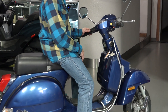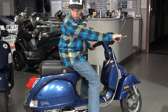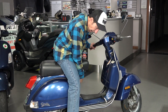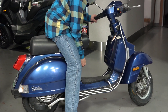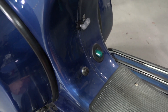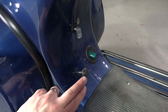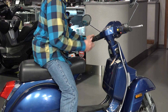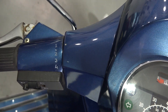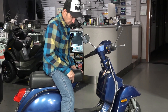On this scooter some things are powered by the battery. It may have a bad or weak battery and not have anything function, but you pretty much have the electric start and that's important for easy starting. To start it for the first time you have your fuel lever — when the lever points left that's fuel off, and you'll see a C on the lever. Turn it straight up to 12 o'clock and fuel is allowed to flow. Turn that off when you're not using the scooter. This is your choke — use it on a cold day or first start. Pull the clutch in, and if the electric start works, make sure it's in neutral. Once it runs for a little while it should idle just fine once it warms up without the choke.